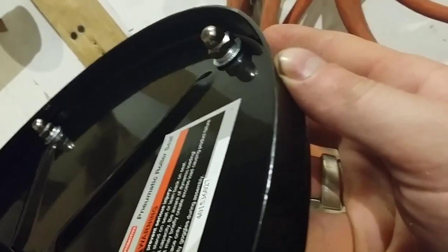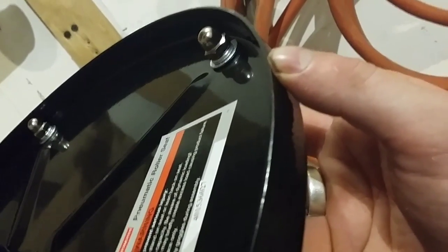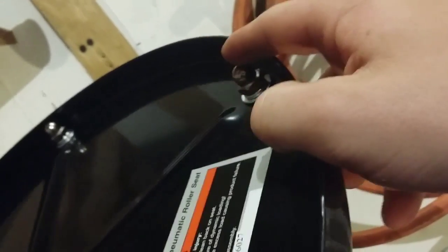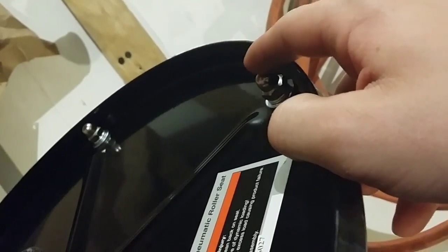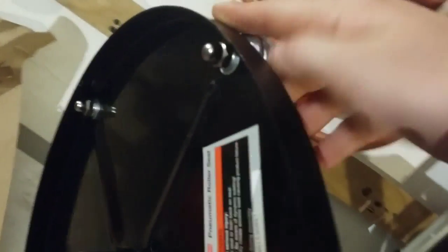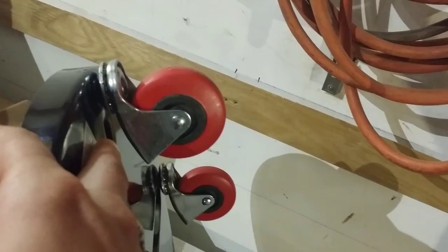It's not going to bend on me if I hit a rock on the driveway, so I'm not too worried about that. Let's see how these wheels are attached. It looks like we have a washer to distribute the force of the fastener, a lock washer to get some pre-tension, and then a crown nut — so you don't have any threads sticking out. That's a pretty quality idea to put a crown nut on there instead of just a regular nut.